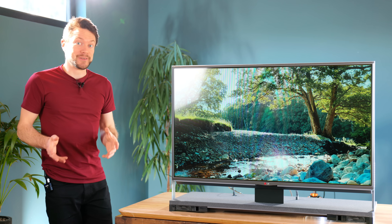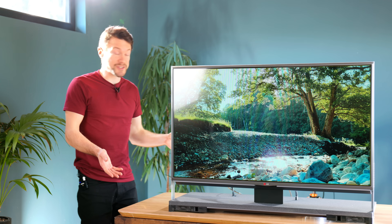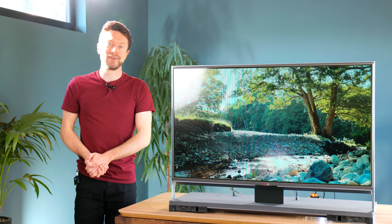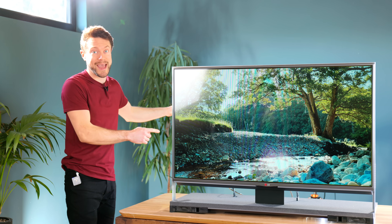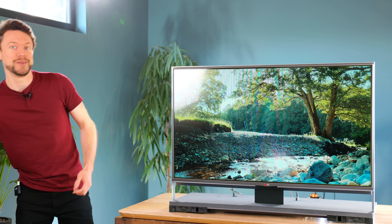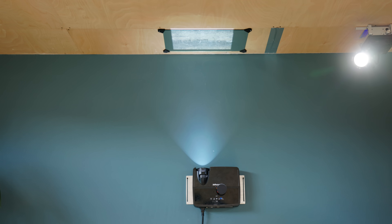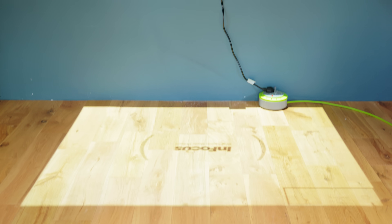The easiest solution for this would be to go with a short-throw projector, which could literally just sit directly behind the TV, lighting it up in a very compact fashion. But using the long-throw variety of projector like the one I have is still possible if we fold the light path using mirrors. By mounting a small mirror to the ceiling, it allows the projector to be wall-mounted as the mirror will bounce the light back down towards the floor.